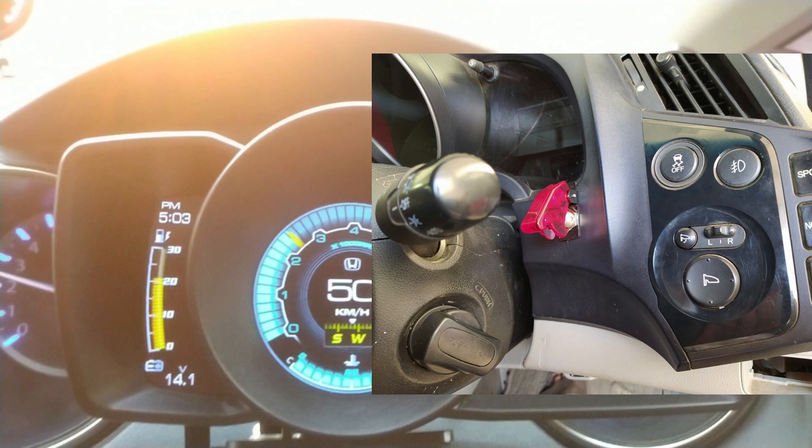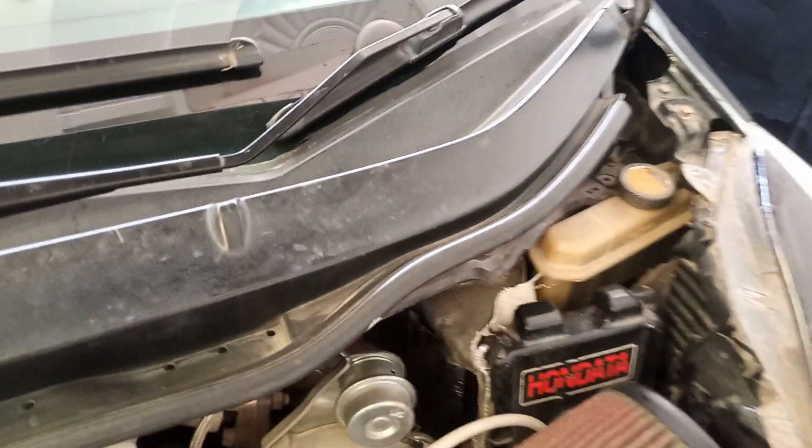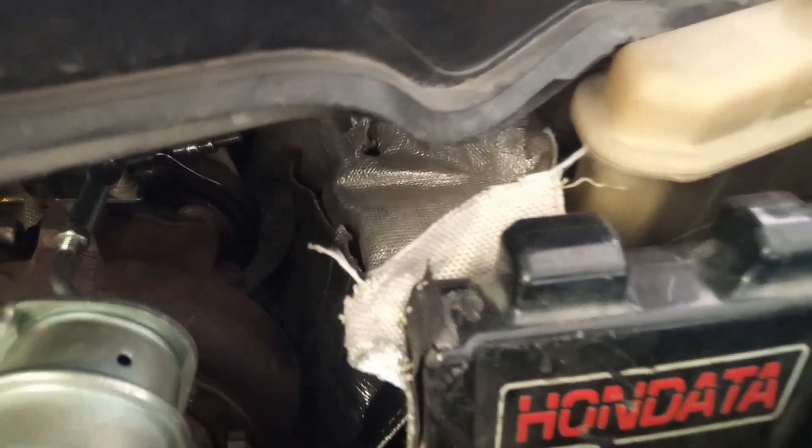Yesterday I went for tuning and each time I had to lift this whole shield to access the wastegate settings. What I did today with a cutter blade is I just made a small notch here for the low boost and a small notch for the high boost setting. Now I can easily change both, then cover it back up so it will be protected since they are near the turbo.